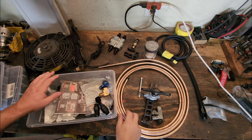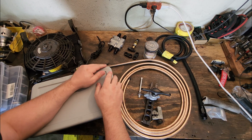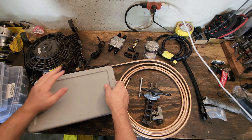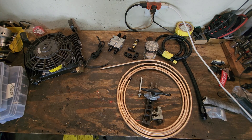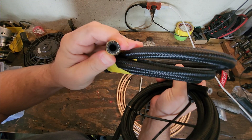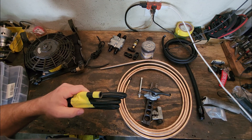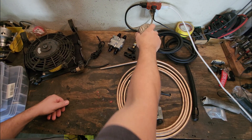When it comes to selection and choice, I like to use Evil Energy, which is made in China. Why did I go with Evil Energy? Because of cost — it costs a lot less, and I haven't run into too many issues with it. I've used them on both my oil lines and fuel lines. Now, on my fuel lines, because I do E85, it's got this Teflon-type tube inside, which is not going to break down versus a rubber inner liner. If you run E85, it's going to break down the interior of the actual hose — something to pay attention to if you plan on doing a turbo E85 type setup. This Dash 8 or Dash 6 line is good for regular fuel or regular gas.